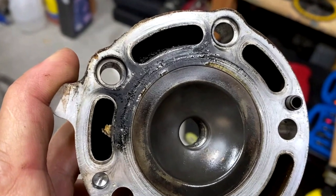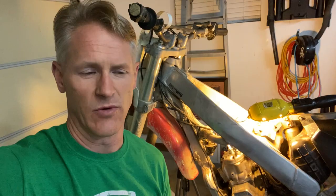Let's talk about what I think happened to the motorcycle when it failed last time. When we disassembled the head and cylinder, there was a really dark spot between the combustion chamber and the water jacket. I think we were losing water either from not having the head nuts tight enough or maybe the head was warped from overheating before. It probably just lost coolant through the combustion chamber — basically burning water — and once all the water was gone, it overheated and seized. I'm not certain that's what happened, but there was no water in it despite Alex saying he put water in, and the discoloration is what made me think that.